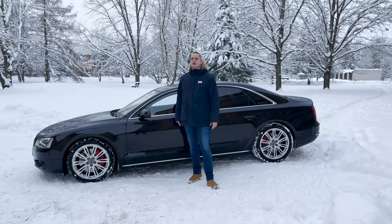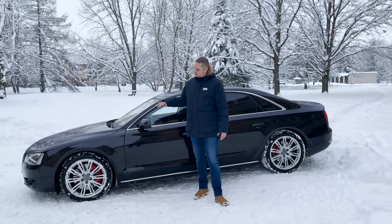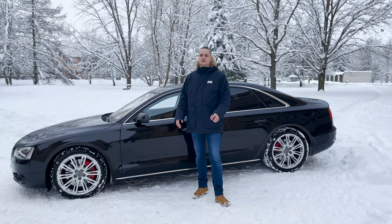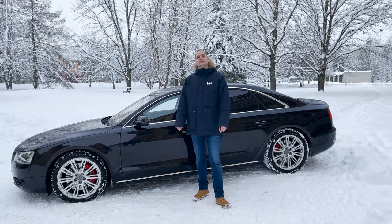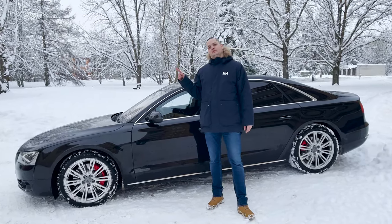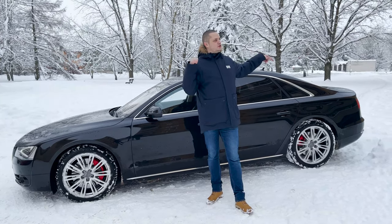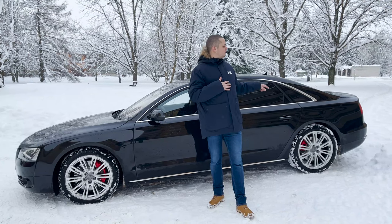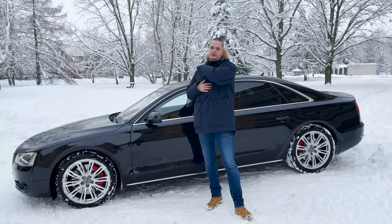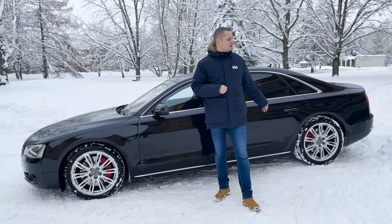I thought I would make a second video a little bit faster than I planned, but the parts needed to install the Chromecast for the rear monitors came a few days ago, so I didn't have anything to show you. In this video I plan to install the Chromecast on the rear monitors. I will show you how I take the wires from the trunk 12 volt socket, then take them inside the interior and connect them to the AMI socket.